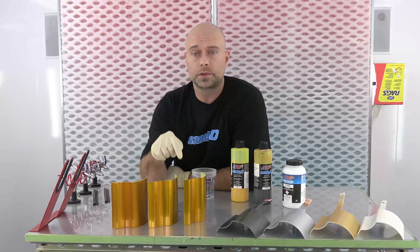That's the six to one right there. I'm going to mix this up extremely well, making sure all that white on the side of the cup is gone — you really have to be methodical. I'm spraying with a full size gun, my Supernova 1.2 Evo — that's my go-to. Because I did six parts 4050 to one part candy and I'm using a full size gun, I am not going to reduce this. You can see that flow off the stick — that is pretty much the sweet spot in terms of viscosity. If I was using an airbrush or a smaller tip like an LPH 80, I might add a splash of reducer. But with a full size gun, even a 1.2, it's going to be fine with just the candy mixed in — no need to add reducer.